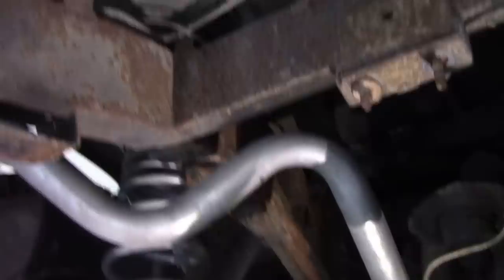Moving along — this section never really rots out, it's well protected. But these back corners are particularly bad. These body supports often go as well — it's not the chassis itself, but while we're under the car, they get neglected and often missed when rust-proofing. You can see there are drain holes in the bottom, but it would be wise to give these a shoot of good wax before we put the tank back in.